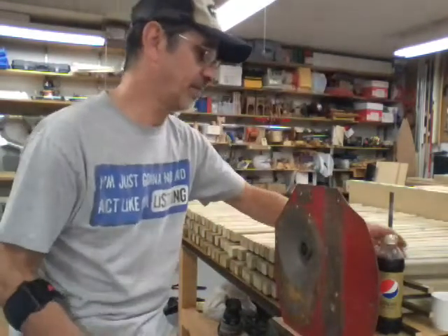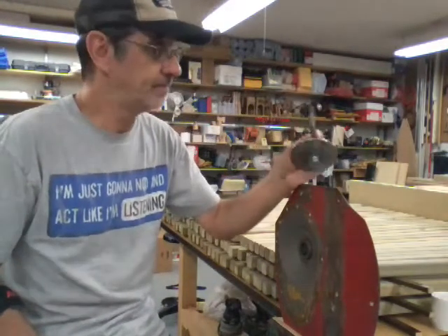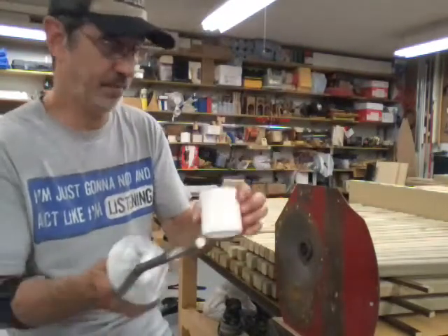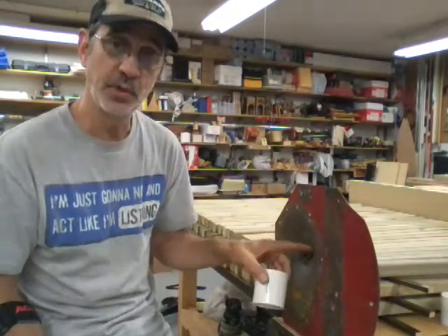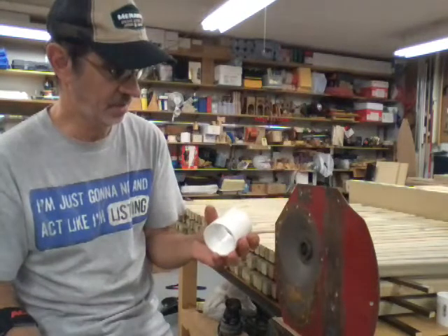The tool I made — you'll see it in some of my other videos — is just a bunch of hardware parts to press these out with. I've got a fitting for a PVC pipe. I've got two of them but really you only need one. This bigger one is because it has to span not only the bushing but the grease fitting that's sticking out in the way, so I got a bigger one for that. The smaller one was for the differential side, but why buy two? Just get the big one — I believe this is a two-inch.